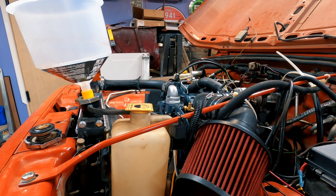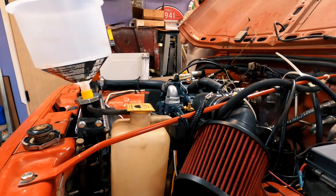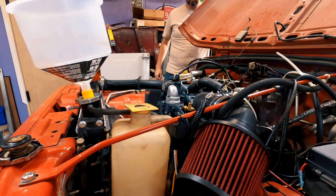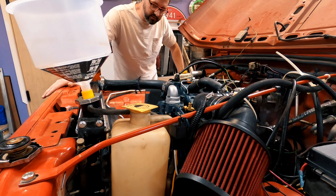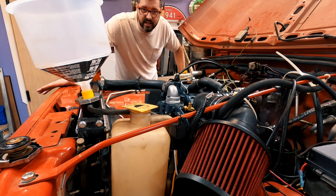I'm not completely convinced it's sealed. I'm going to open the shop and turn on the engine — it's going to make a lot of noise because I've got coolant everywhere — but I just want to see if coolant starts seeping out from that housing. If so, we need to drain the coolant again and take more material off that housing. That was actually really successful — I'm a little surprised. We're going to button this all up, take it back outside to a hill, and bleed the coolant system again. This time we don't have to wait for the thermostat to open because there isn't one.